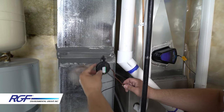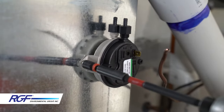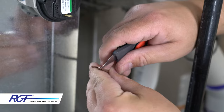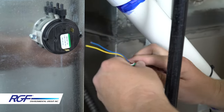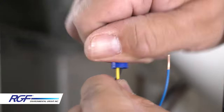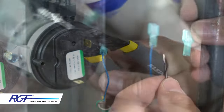If you haven't mounted your air switch yet, go ahead and find a location that you like and mount it now. I usually mount mine to the return duct because there's less vibration and heat there. If the supplied power cord is long enough to reach the air switch and the Halo LED, split one of the low voltage wires and put a quarter-inch tap on either side. Plug each one onto one of the terminals of the air switch — it doesn't matter which one connects where. If you had to lengthen the wires as I did in this install, you'll have the wires coming from the transformer and the end of the power cable feeding the Halo LED in the same spot. One of the wires coming from the transformer and one of the wires feeding the unit will be wire nutted together. The other wires will be connected to the air switch, so you'll need to crimp on a quarter-inch connector to each and plug them onto the air switch.